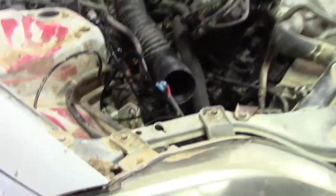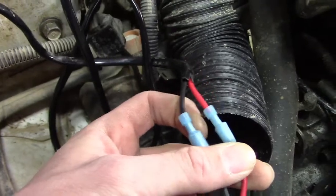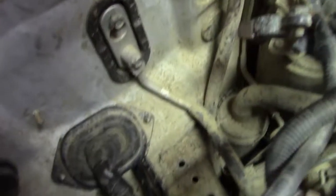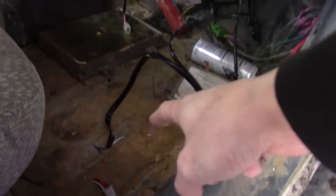Didn't really think I needed to show everything in the time lapse, but got this stuff wired in two separate harnesses. I got two switches left on the panel, so that works out pretty good — pod lights are on one switch and the little bar is on the other switch. Got everything wired in with connectors and then into the cabin it goes in the same place as the factory wire harness. Got my two separate harnesses so I'm just going to run the grounds and then run two powers up to the switch panel and then put the battery back in.